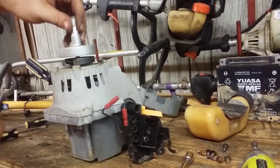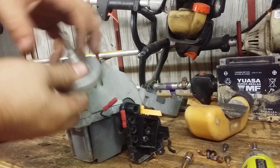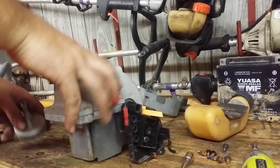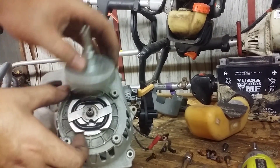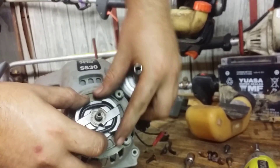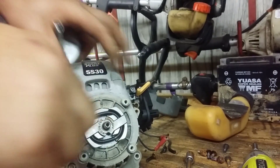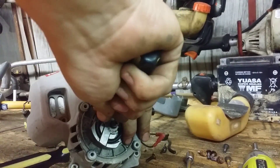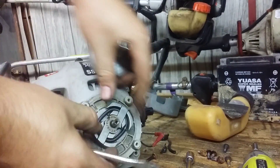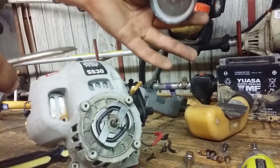Got this socket. Inside of this clutch there's a little bitty screw — you have to get in there with a flathead to be able to get it off. Now you see how this is spring-loaded: as the engine spins up, the centrifugal force pushes these shoes out. They're under pretty good tension, but they'll kick out along the sliders here, and that's how you get the friction to spin your weed whacker.